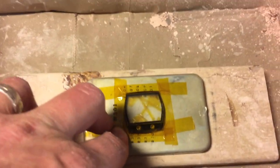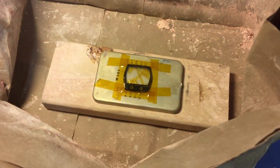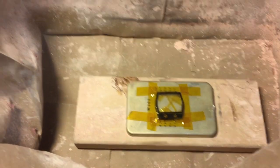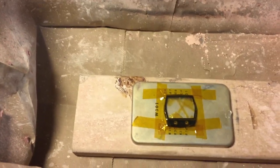What I did was tape it down to an old piece of scrap aluminum to get the heat off of this thing. This is how I do watches that are still cased as well. I put it in a half cut-out paper bag to catch the cerium oxide, which is over here. Now we're going to hit it with that over and over and over again until it's polished, following TB's procedure which works quite well.